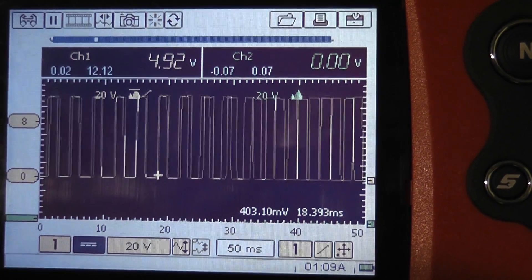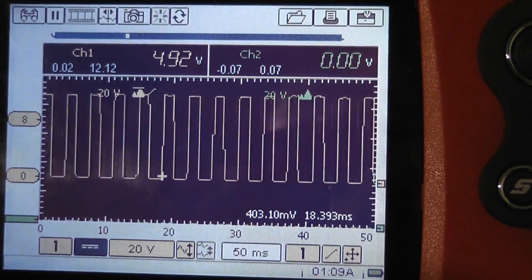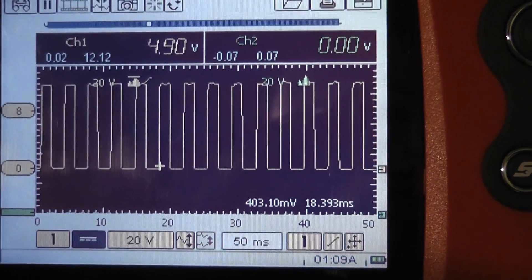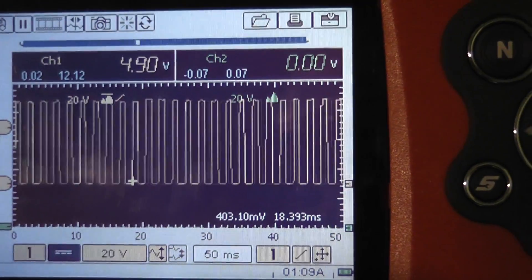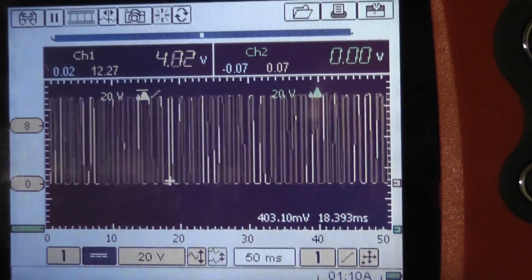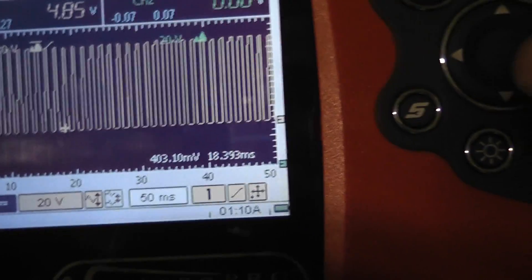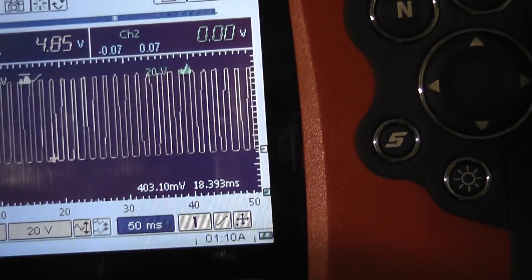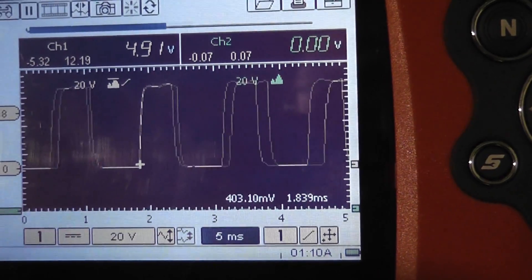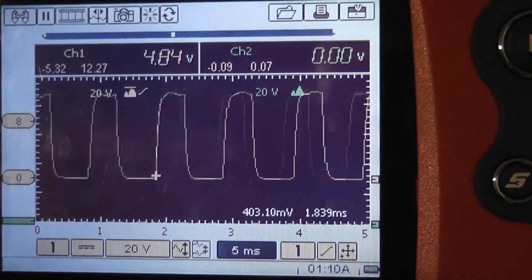Finally, I want to show the signal at different loads. If you're looking for a glitch or dropout in this signal, changing RPMs is important to view it at different ranges. Go ahead and raise the RPM — snap it a couple times. It's very difficult to see any kind of glitch or dropout on this particular waveform. You can drop your time base and do it again — that helps, you can see it a little better — but there's an even better method.